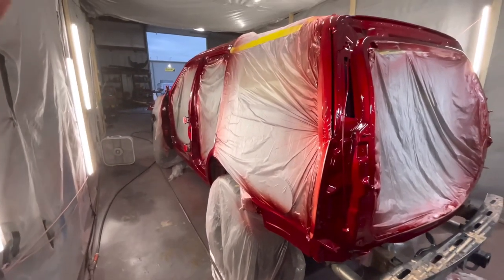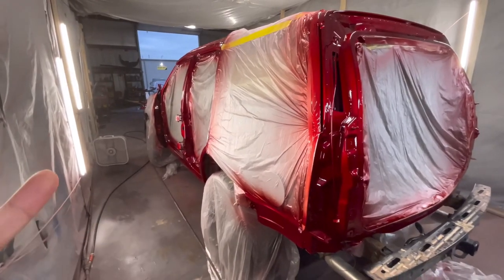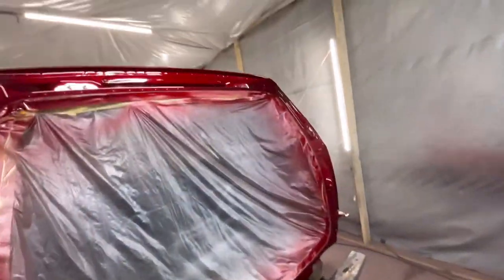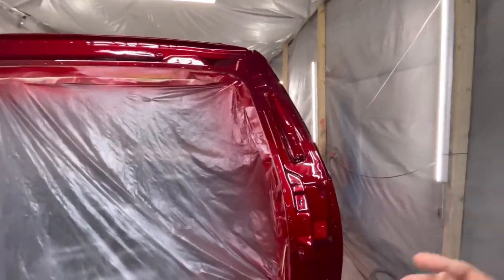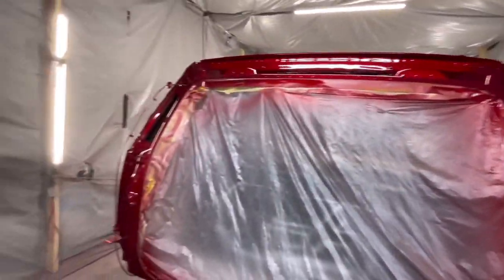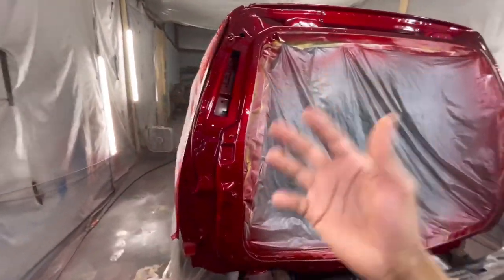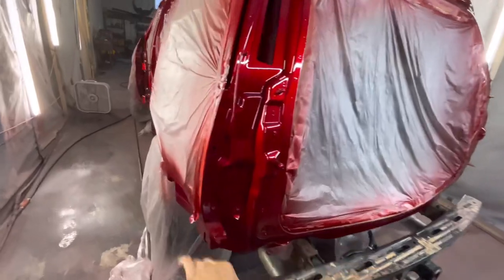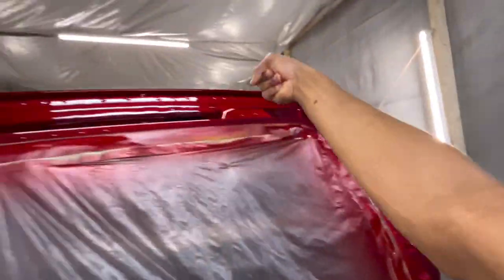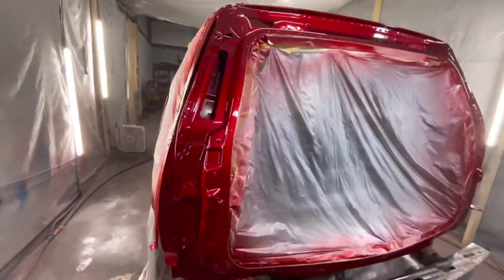So it's very critical that you stay on top of that and avoid hammering certain areas more than once. You'll see me do this when I'm spraying, and it's such a habit. But anytime you spray, you want one coat, boom, all the way around, boom. You want the same amount of distance, you want the same amount of layers of paint.